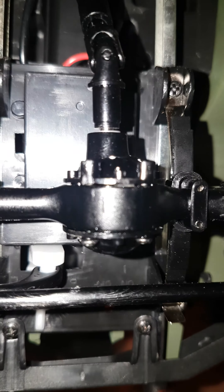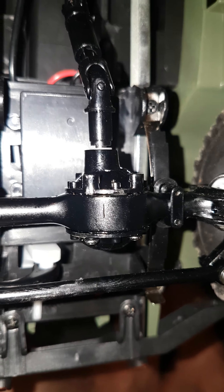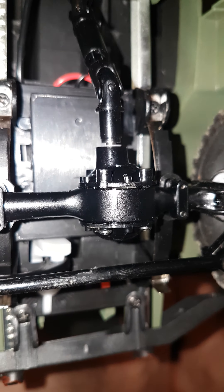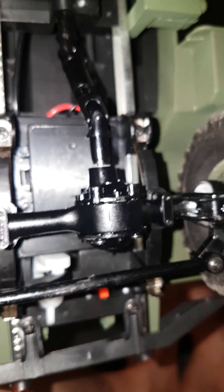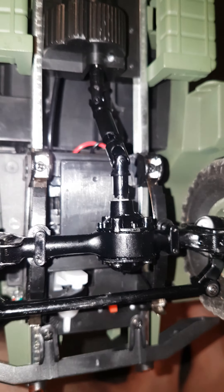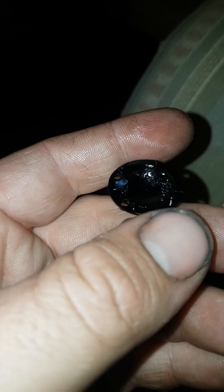The things you notice when you look closely at stuff. I'm going to put these screws in the back diff and then try and undo the front diff, because I heard a bit of a clicking before and it might be the gap between the gear off the tower shaft and the crown wheel. If I can make them fit together better, there'll be a stronger or better mesh between the gears. Got the rear inspection cover off on the front diff.